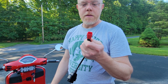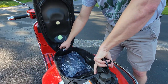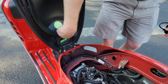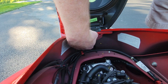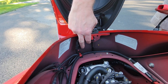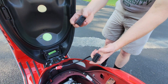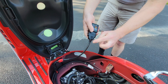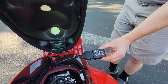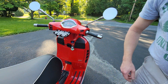They don't really tell you in the manual where the connector is, so I'm going to show you. Open the seat, take out the cargo carrier, and right up underneath the hinge you'll see this red connector. Push it with your thumb and remove it. There's a dummy plug in there to keep the dirt out, and you can see the 6-pin connector. The adapter plugs into the 6-pin connector, and your diagnostic tool plugs into the standard 16-pin.